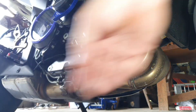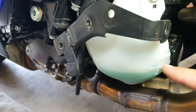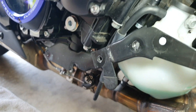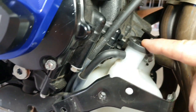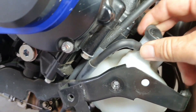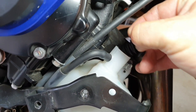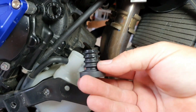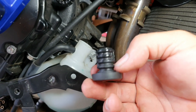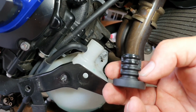As you can see, the coolant level — that's the low level line there, that's the high level line — so it's taken a little bit of water from the reservoir and topped it up into the radiator. Just here is where we fill up the coolant. This is just a rubber grommet — for want of a better term — I'll just pop that out like so. That's the grommet there. Pretty simple setup at the end of the day. I'll set up the syringe with the little hose and poke it down and we'll top it up with some coolant.